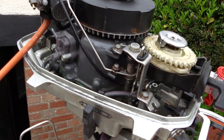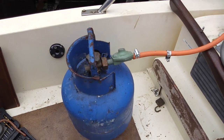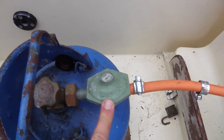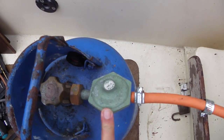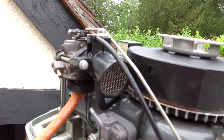I tried a couple of things. What I've got here is an old calor gas propane tank. That's the ordinary cooking regulator, so that's limiting the total output somewhat to about the same amount a cooker would use at maximum. All I've done is take off the float chamber and jam the end of that hose onto the casting where the jet goes in. So essentially that's pushing gas into the jet and also into the slow running jet on the other side, basically pushing gas into the venturi.